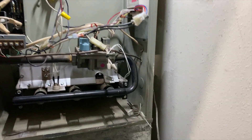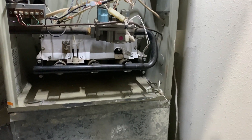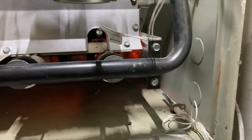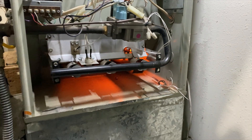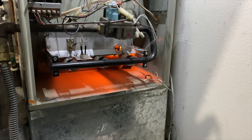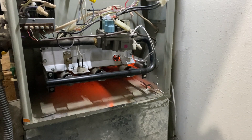Don't worry, I'll clean it all up once I verify it works. Got her powered up, we got a green light — awesome. Gas is on, gas valve turned on, yes it is on. Okay, I heard a click — we have igniter. We should be getting gas valve shortly. Stand back just a bit just in case — never put your face in this until you've seen it light the first couple times. Okay cool, we got ignition!